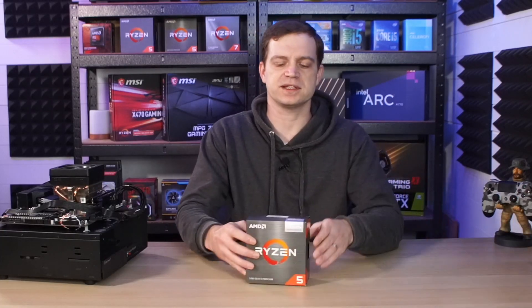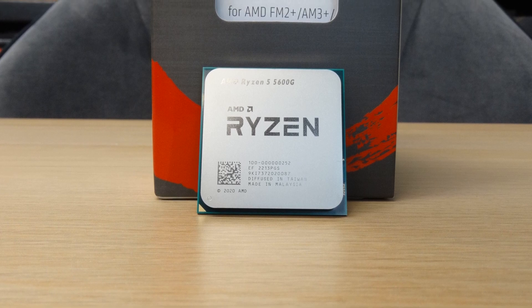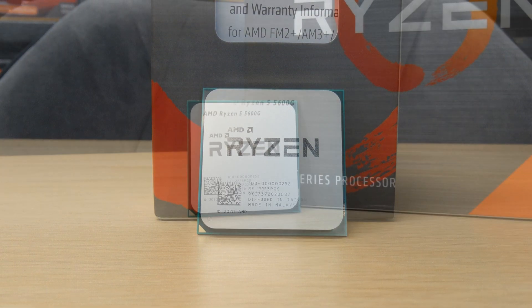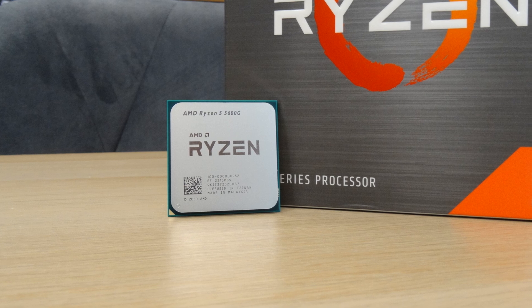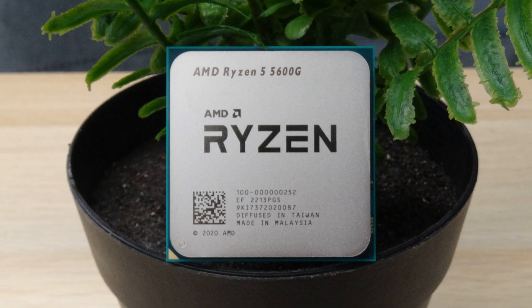This one that we picked up is one of AMD's latest. I say latest because obviously it's a 5000 series and AMD have recently released their 7000 series, but they haven't actually released any APUs yet. So if you're going out there to buy a latest APU, this is probably one you're going to pick up. This is the AMD Ryzen 5 5600G, and unlike its predecessors that only have 4 cores and 8 threads, this one actually has 6 cores and 12 threads, which makes it a pretty strong CPU all on its own.